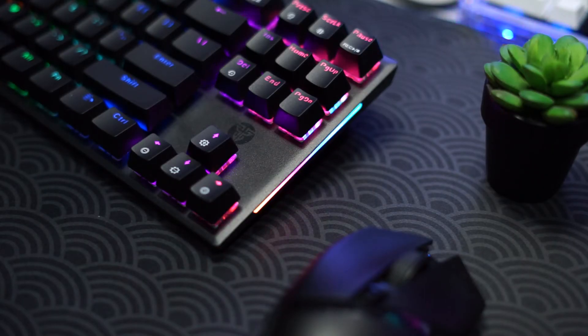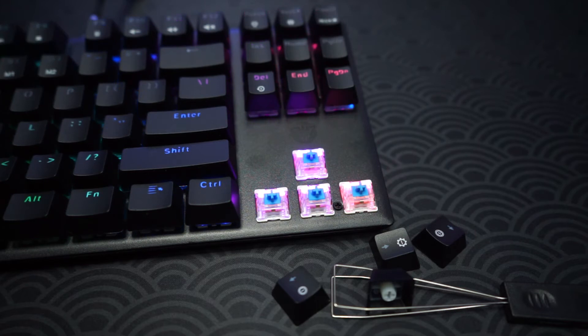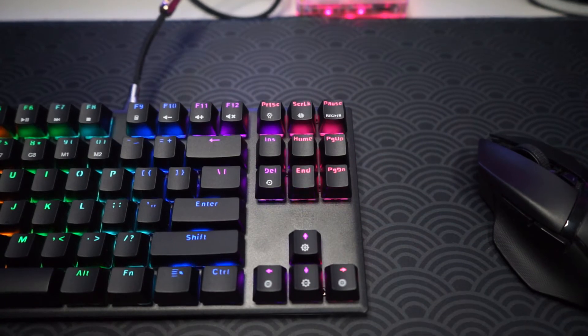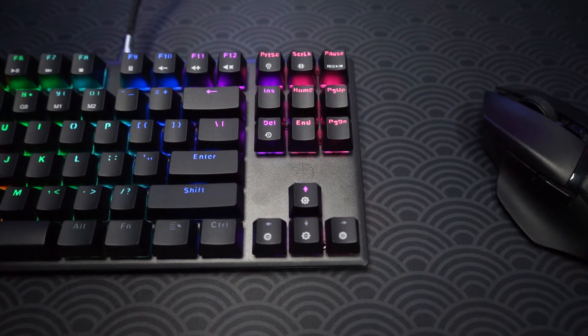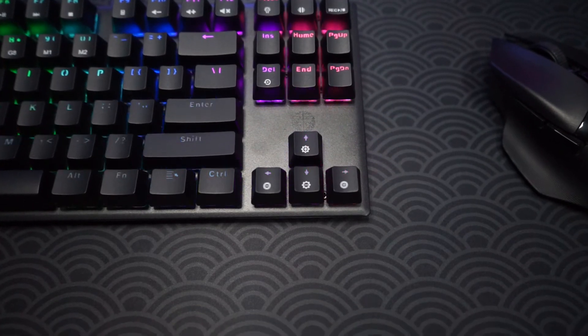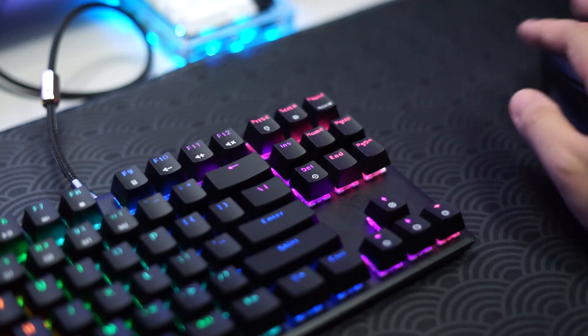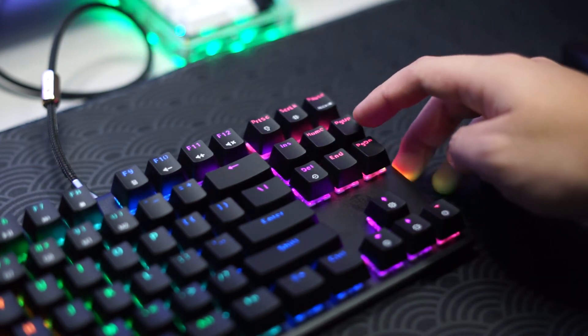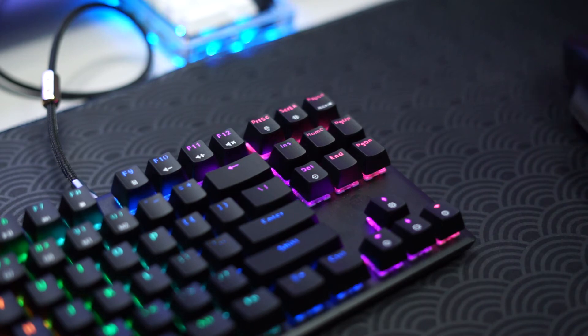Now for a few things I don't really like about this keyboard. It's priced at around 150 ringgit which is good, but a lot of keyboards now offer hot-swappable PCBs so you can switch out switches for ones you like. The blue switches I got here are not changeable unless you know how to de-solder. The pre-lubed stabilizers are decent for this price but you sadly cannot remove them to mod them since the switches are soldered in. The furthest you can go is change out the keycaps. You can try modding the case but the low-profile design means nothing will likely fit inside.